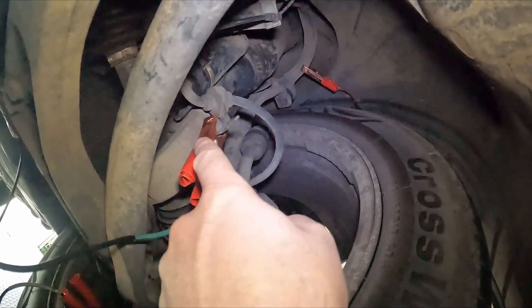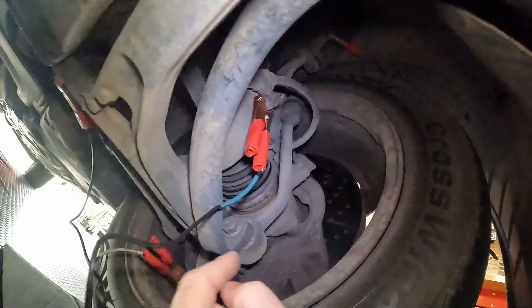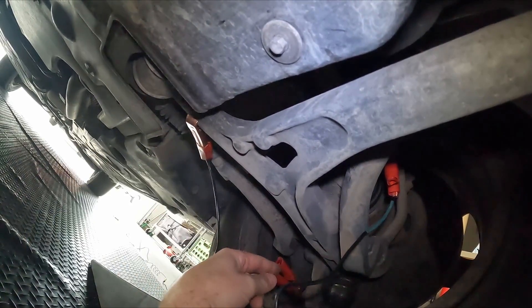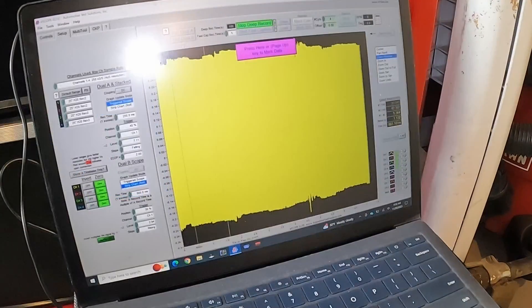We have this one on our strut tower — there's a little joint at the bottom of our strut tower on this vehicle, so we're going to see if that's our issue. We still have the ball joint there, and then this one is on our control arm near the bushing. Let's go back and see if anything is louder than our ball joint. I'm going to hit play.